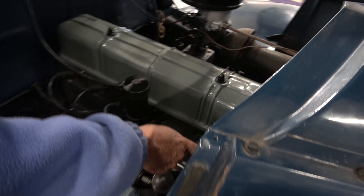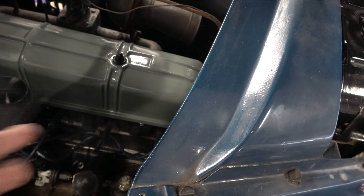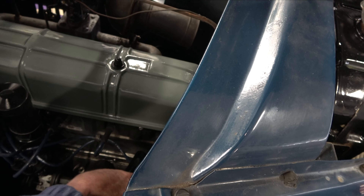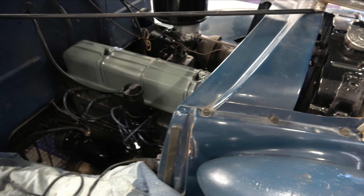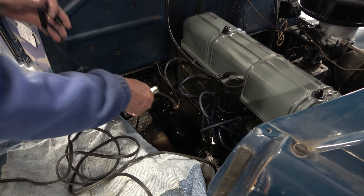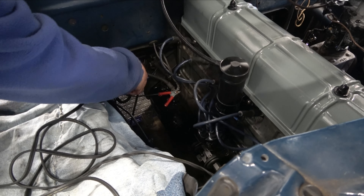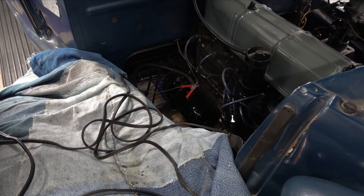On the 6-cylinder, the very front one is always your number one plug. So we're just going to put that reader up on the number one plug, and you've got to have electricity to make this work. We're going to come off our 12-volt positive over here and come off our ground here just like that — and that hooks your light up.